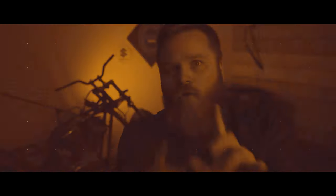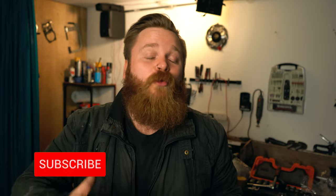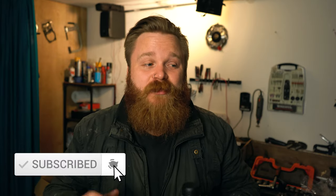Hi guys, and welcome back. So today I'm going to be covering a topic that so many of you have been requesting, probably for the better part of three or four months now, and that is how to bleed the clutch. Along with that I'm going to show you how to bleed the brakes, and I'm going to show you how to do it using the reverse bleed or back bleed method. You're going to need a few things to do this - first of all, go hit that link in the description and pick yourself up a big syringe like this and a piece of PVC tubing.